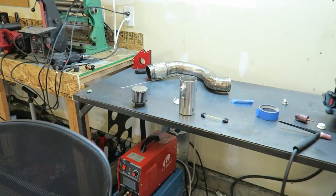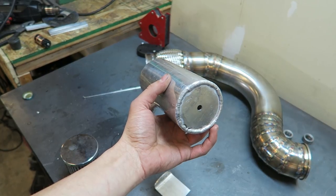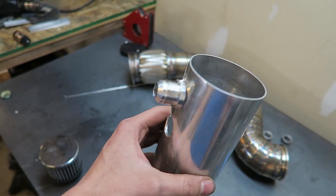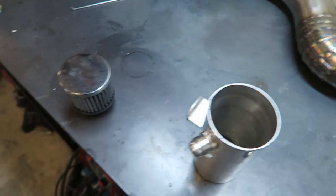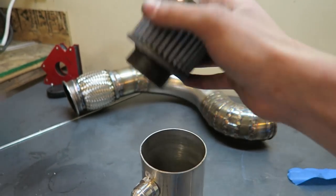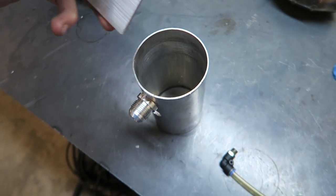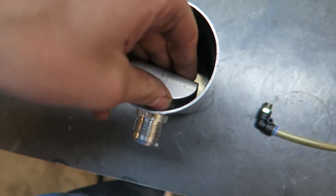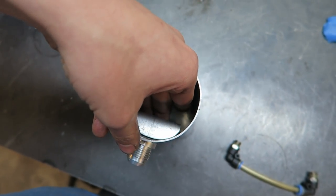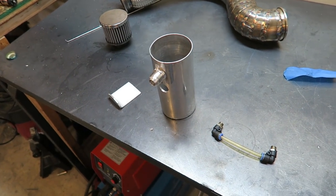It's over here, I already have most of it done. All this is is three inch intercooler piping, and then I just hole sawed a three inch circle out of it, got that already welded on the bottom. I have one fitting already tacked on there and I have this filter that's going to go on top of it — it actually fits inside of it, you just press it in there. I also have this baffle made that I still need to weld in, and that will just help direct the oil down into the bottom of the catch can instead of trying to fling out of the filter. So I'm getting that done right now.